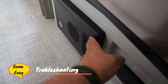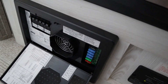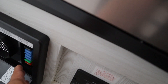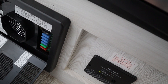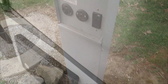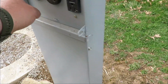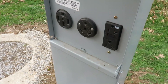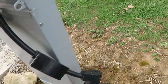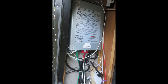If you ever have trouble with your electrical system, push this button here to open this panel and you'll see your circuit breakers — these are for your AC coming from the electrical box at the campground. Over here is your 12-volt fuse panel, so you may want to carry a few extra fuses. Also check the circuit breaker on the outside pole where you plug in to make sure it's properly turned on — sometimes you want them off when plugging in, then turn them on as needed.